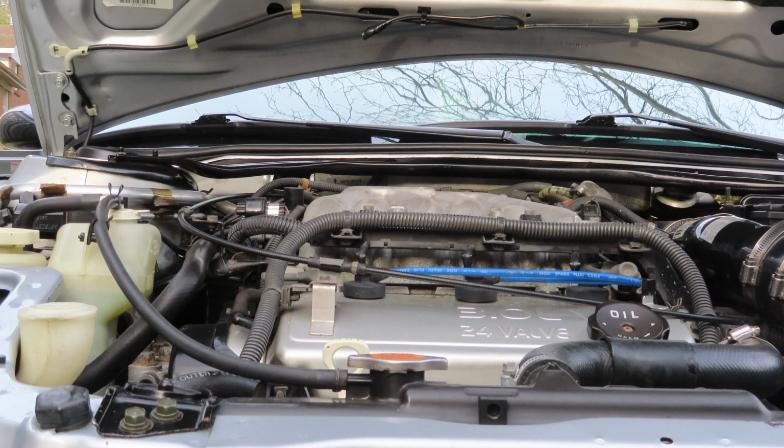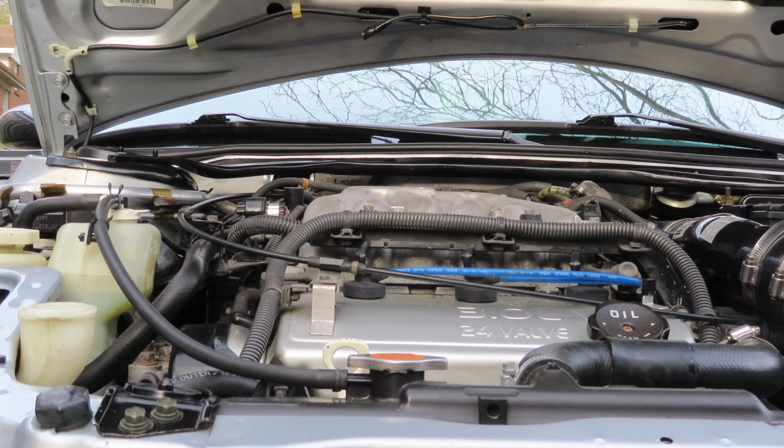How the process works: oil starts off at the bottom of your motor and collects in your oil pan reservoir. Then, from that reservoir, your oil pump sucks the oil out through a pickup tube and takes it to the oil filter to be cleaned of all dirt and imperfections. After the oil has done its cycle through the engine, the filter cleans microscopic particles and sends the clean pressurized oil to the top of the motor.